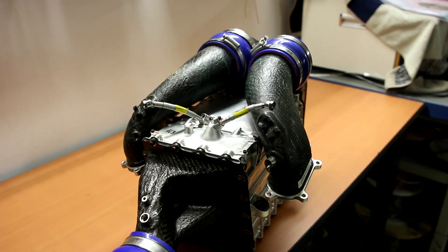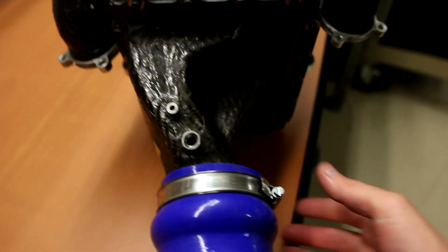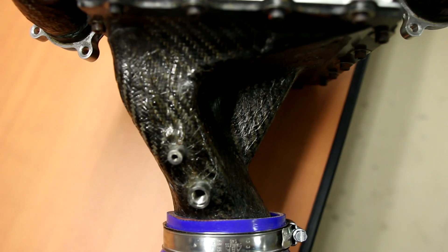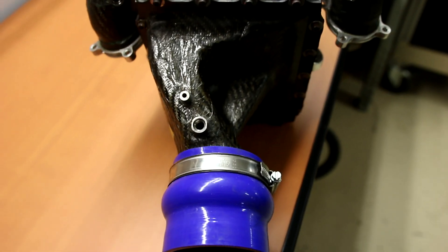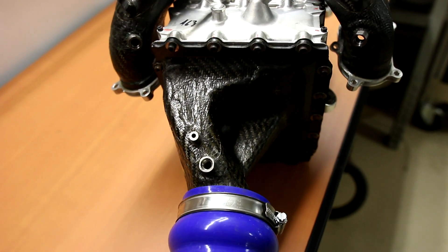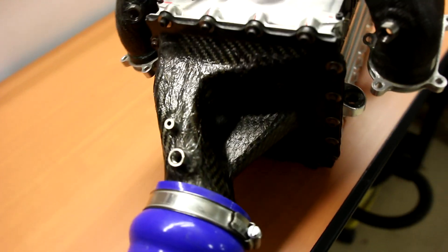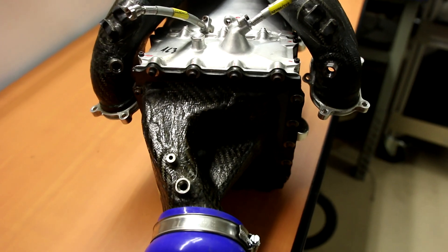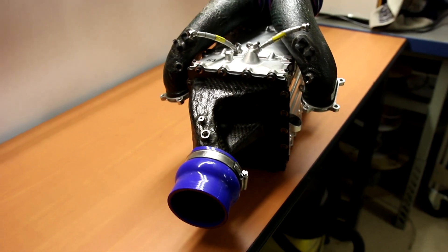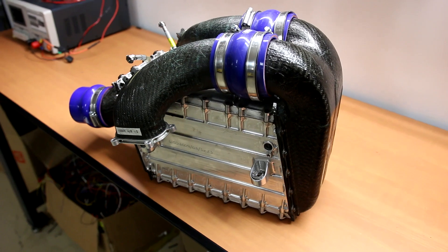The engine output was 800 horsepower, but my plan is to have more than 800 horsepower, so maybe I need two of them. As you can see, the inlet design — I think they do this for packaging to make it small, but also to keep the velocity of the air at a constant speed. A normal intercooler usually has a big cone that causes the velocity to drop. Okay, I will open this up and see how it looks on the inside.